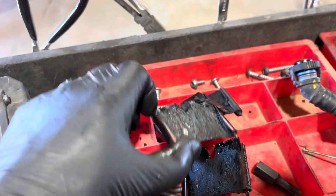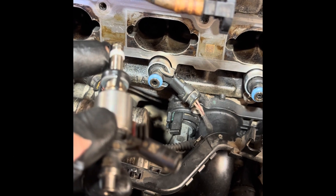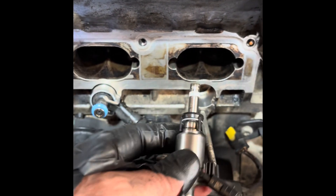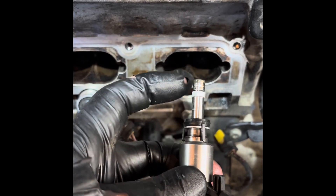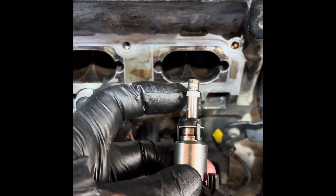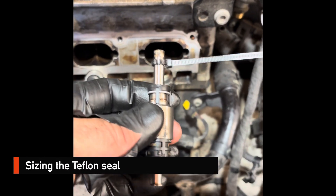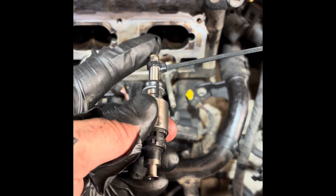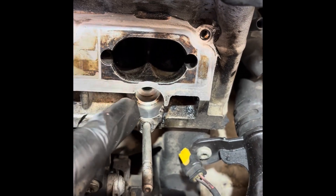Now for the direct injectors — these direct injectors come with a replacement kit. There's a Teflon seal you have to replace at the top and then two seals at the bottom. They're kind of a press fit. The Teflon seals are sized, so you have to stretch them to put them over the injector. Sometimes I use a zip tie to compress the seal and then insert it — once the seal shrinks, I let it sit for about five minutes, cut the zip tie off, and then I'm able to insert the fuel injector into the head. Again, this is direct injection, not port injection.